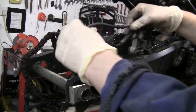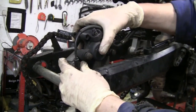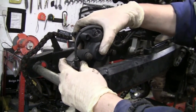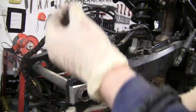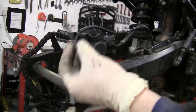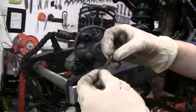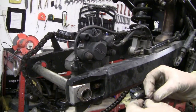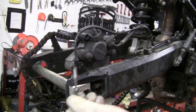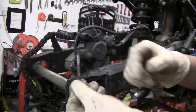We've lubricated that pin. So this can look how easy that moves. It's exactly what you need. Next is t'other pin. This is the one that's giving you the bother. I can bloody guarantee it. Clean it up. Do not use sandpaper. If need be, get a green scourer with a little bit of washing up liquid on it and give it a scrub.